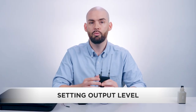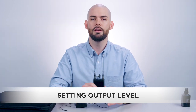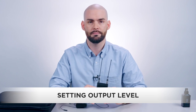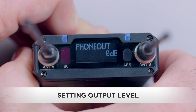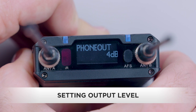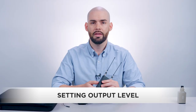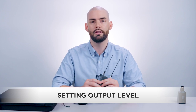To adjust the headphone output, we'll use the receiver's toggle function. This lets you quickly, but temporarily, switch the control of the up/down buttons between main and headphone outputs. Double press the power button. Output phone will appear on the screen. Use the up/down buttons to adjust the headphone output. The screen will read phone out along with the output level. Press the set button to save the change. After approximately seven seconds, the up/down buttons will return to controlling the main output.